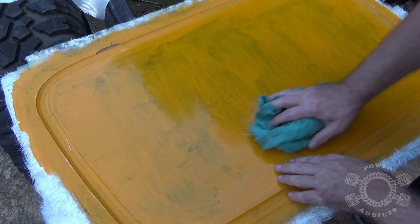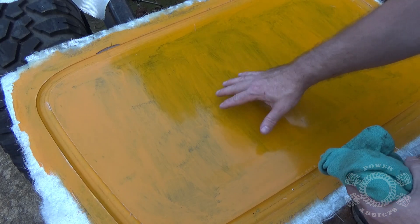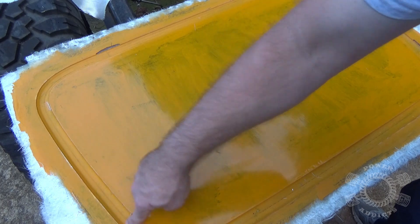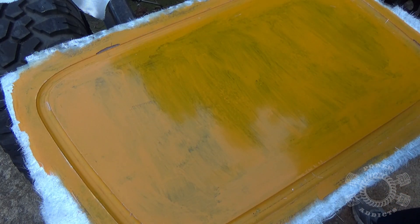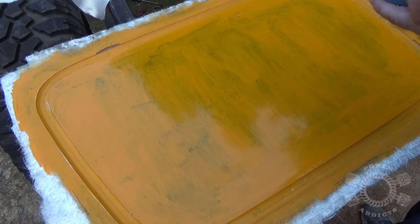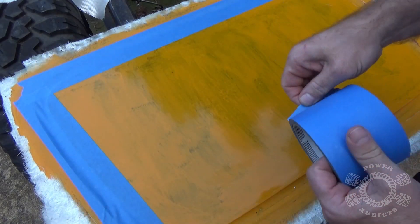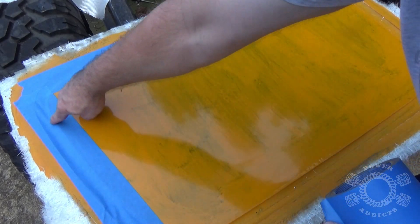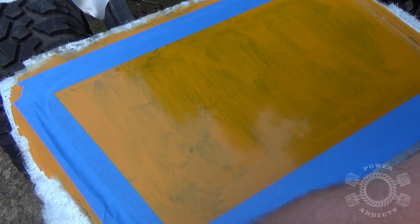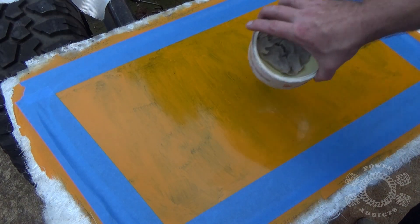We're still gonna wax again. I don't want to damage this area right here because I may make a fiberglass panel for my CJ7 top later. So all this area I'm gonna tape up. I've got a patch where I had a big air pocket right there. Plain old masking tape — nothing special. There's no certain magic to taping off; I'm just protecting those grooves and I don't want any fiberglass resin inside those.